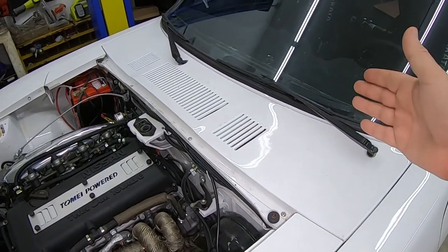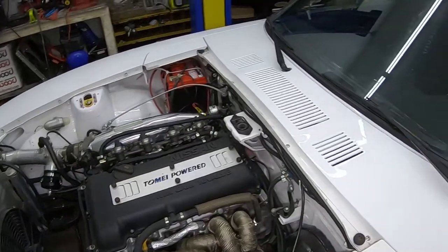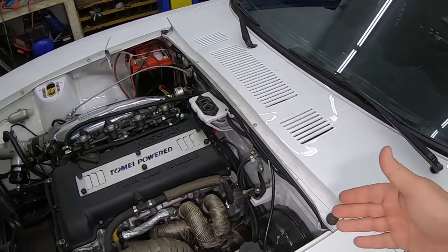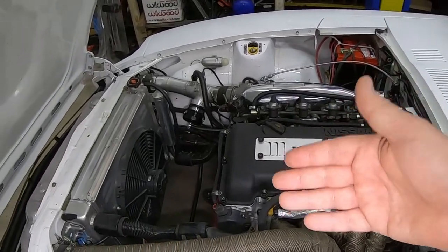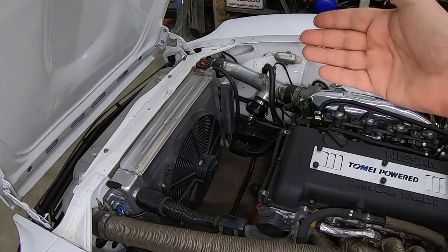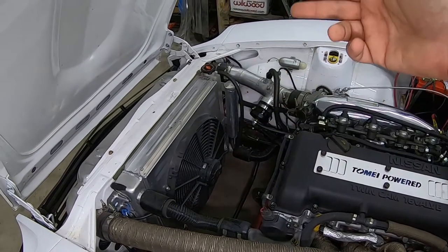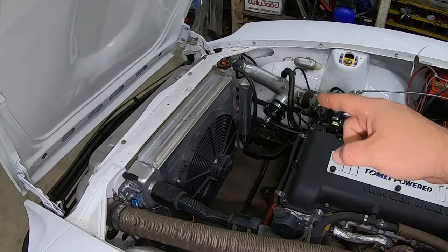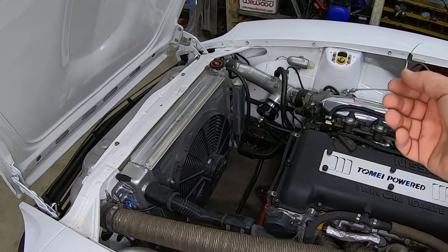They pull all of the current required to run the headlights through the combination switch, which usually burns them up over time. This aftermarket harness that I'm using switched the headlights out for HIDs, put ballasts in there, and then went ahead and put relays at each headlight and then had to pull a separate set of power and then just use the factory plugs to engage the relays.